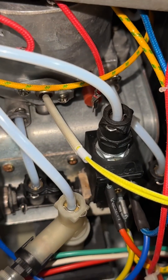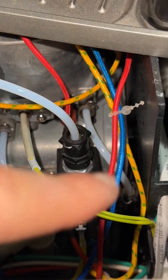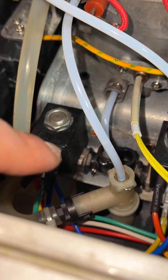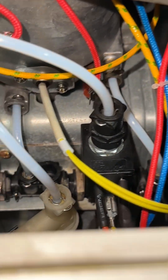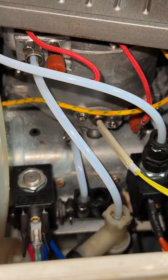I also know that the seals can have a bit of wear and tear, so I flipped around the seals. That one there is the high-pressure seal that goes to the group head, and that one over there is the low-pressure seal. I flipped these around to give that one a better chance to hold and not leak — and it is not leaking anymore, which is great.